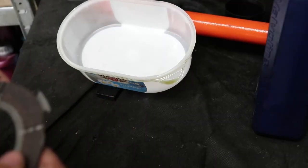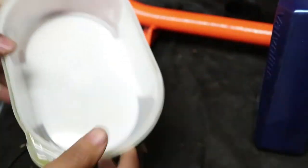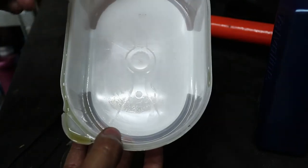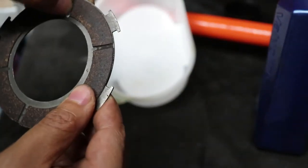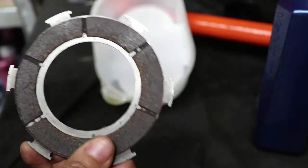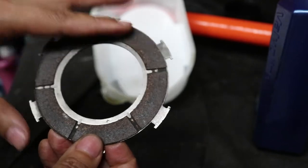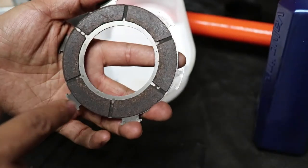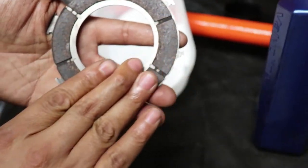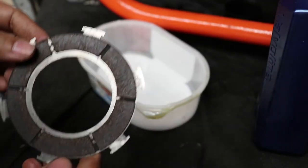The last situation you could face when reading your gear oil is when you drain it into a container and you see some small metal flakes — this is normal and commonly happens in the gear room. But if you find pieces of cork, or little black dust that is not shiny, this could come from your clutch cork plate. This mostly happens when your clutch is wearing out. As the clutch cork plate wears out, it falls apart piece by piece down into the crankcase, and when you drain the oil, if you see a lot more than usual, it is a sign that your clutch is going to finish.